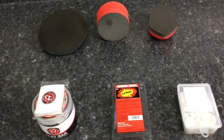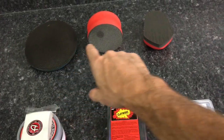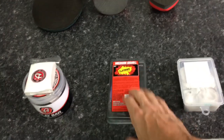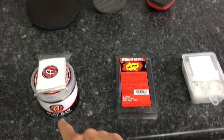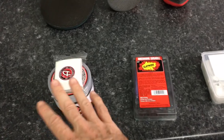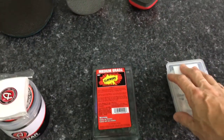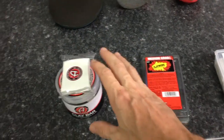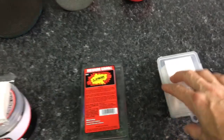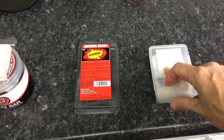There are many examples of both traditional organic clay bars and also synthetic pads and mitts. When it comes to the clay bars, they'll normally come in three grades: a mild abrasive clay bar, medium abrasive, and coarse. These can be taken out of the package, used directly, and stored in their containers. Some are stored in their container with a little bit of moisture and water.